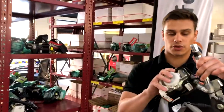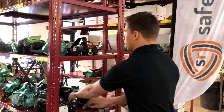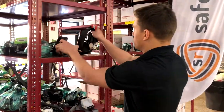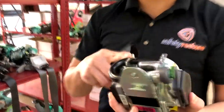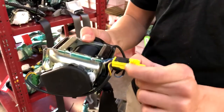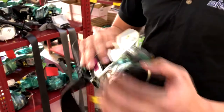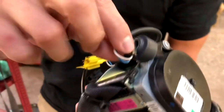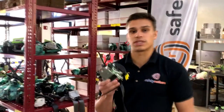Very easy to tell — connected, you'll notice the buckle and the charge right on the seatbelt. Now lastly, sometimes you will notice there is a dual stage seatbelt with both charges on the seatbelt itself. If you look closely here, you're going to notice one yellow connector on this side leading to a plug with a charge, and you're going to also notice another connector on the other side, different color, leading to another plug. You'll notice one, two plugs on the seatbelt. This means this is a dual stage seatbelt.